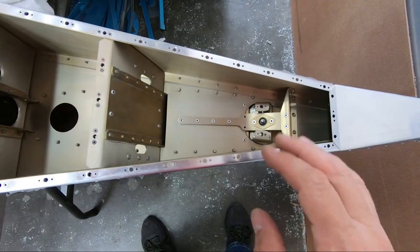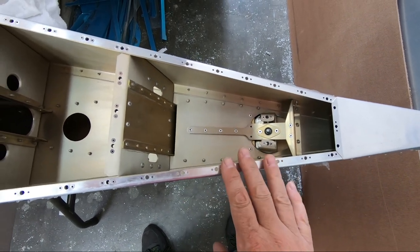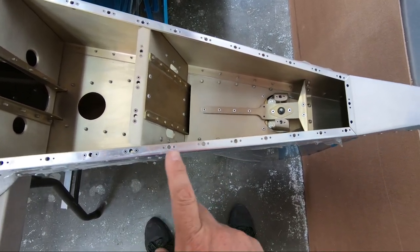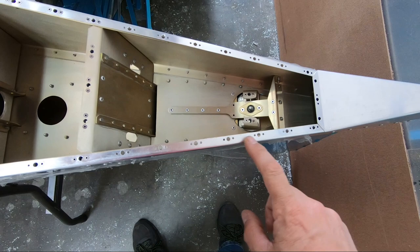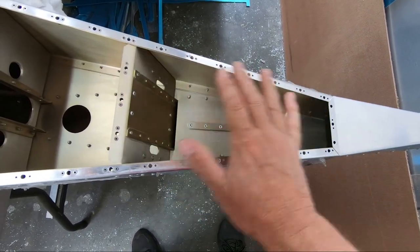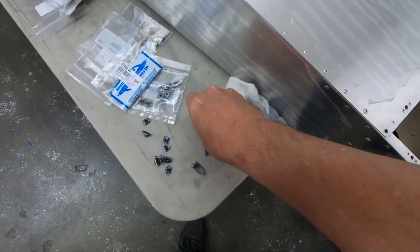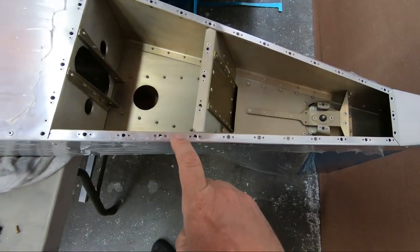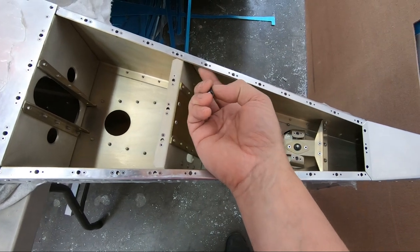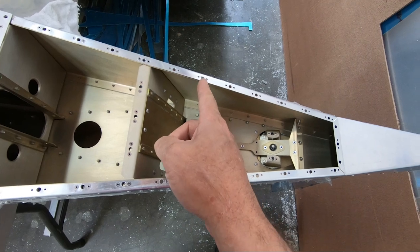The good news is I finally got in some of the hardware I've been waiting for, so we can start finishing up some of the rear fuselage items I want to get done before connecting the rear fuselage to the forward fuselage. Previously we had drilled out all of the nut plate holes since I decided to make a removable panel rather than using the clear plastic one. I've got a bunch of nut plates here — the same ones I used on all the holes up here. We've got thinner aluminum back here because we don't have the angle support that's underneath.